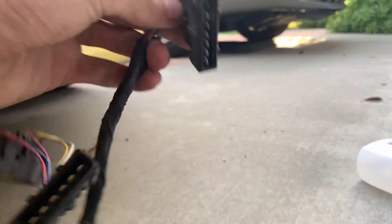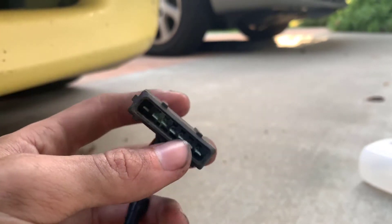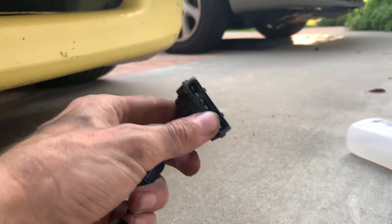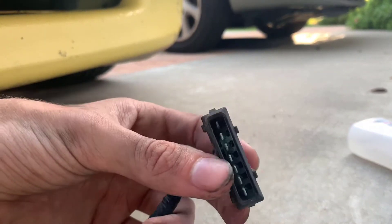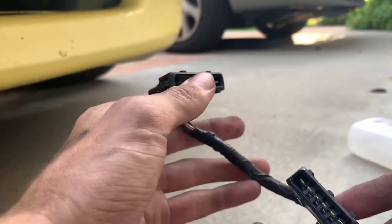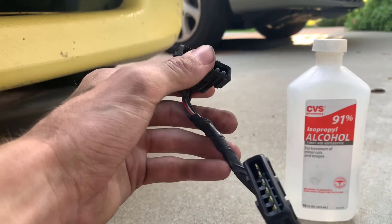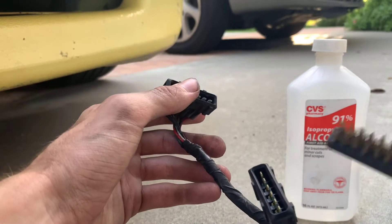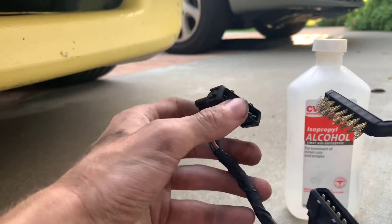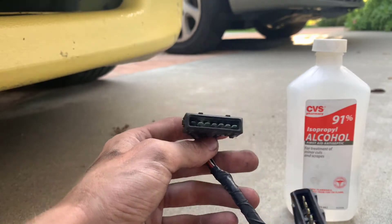With the PTU sub-harness, this is what you want to look for on yours: if it's got that green corrosion in there, you probably ought to clean it off. Otherwise it's not going to work to its best ability — that's how electronics work, it just puts more resistance in there. I usually take some isopropyl alcohol, which is non-conductive, and then a wire brush like this, and clean it out. It usually rubs all of it off, or at least most of it, so it's going to work way better.